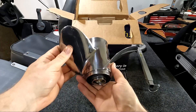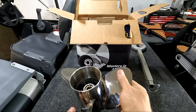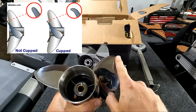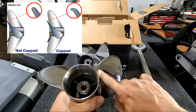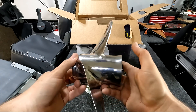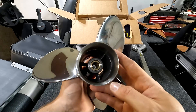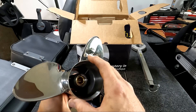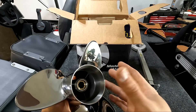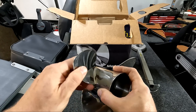Right off the bat, you might notice some differences with the stainless steel propeller. It has this ridge on each blade. Not all stainless steel propellers have this, but it's not something you commonly see with aluminum propellers — this is called cupping. When cupping is added to your propeller, it adds this lip which allows your propeller, when turning through the water, to actually grab more water and pull it down, allowing you to run a little more shallow without blowing out your prop. That's one of the things I'm most excited to try because my engine mounted where it is, I'll sometimes get a little too high in the water on turns and it'll start to cavitate. I'm hoping the cupping might alleviate that problem altogether.